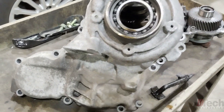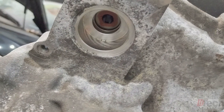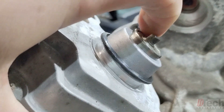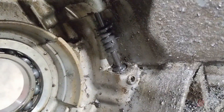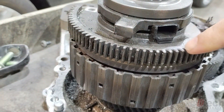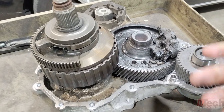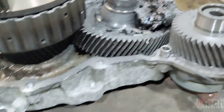I kind of just wanted to do a quick how-to on how these operate and work. So you see that spline there — that's basically a shaft that the motor portion of this module will key into that keyway and it'll rotate and spin. So the worm gear, which is right there, will spin up against this gear here.